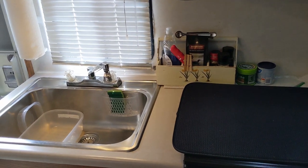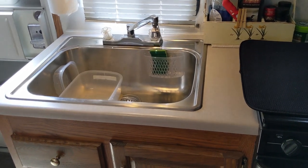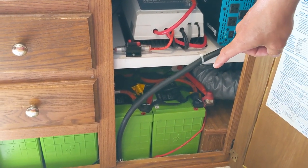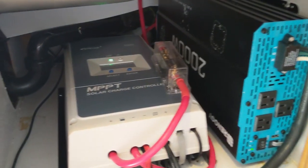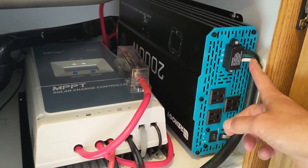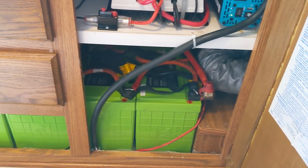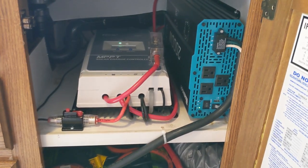This is our kitchen area. I took out the small double sink and put in a massive super-deep residential sink. Underneath in this cabinet, where you might have a garbage can, we now have four Valence 138 amp-hour batteries. We have an ePever 60-amp solar charge controller and a 2000-watt Renogy inverter hardwired to our AC box in the vehicle. That is the entire power system — with big cables throughout. The charge controller is doing all the hard labor.